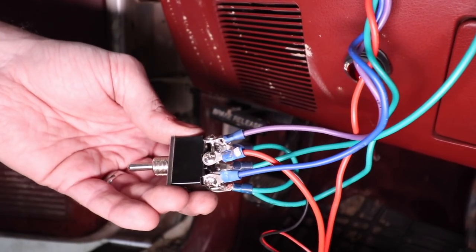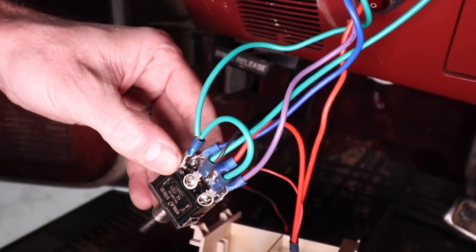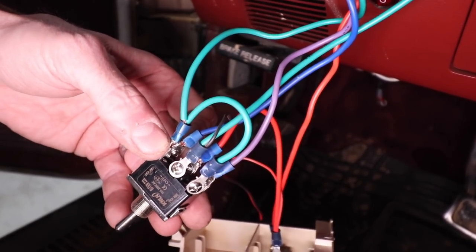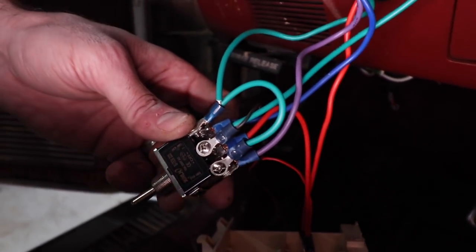Some people splice the brown and black wires together inside the Warn winch to convert it to a three-pole setup — we do NOT want to do that. That eliminates the built-in safety feature that Warn implemented in later winch models. The five-wire setup is safer than three-wire because three-wire only switches power one direction, and we've all experienced a winch getting stuck spooling in or out due to a wiring fault. With five-wire there's a significantly lower probability of that happening because you're switching both positive and negative — if either one fails, the winch simply won't work.